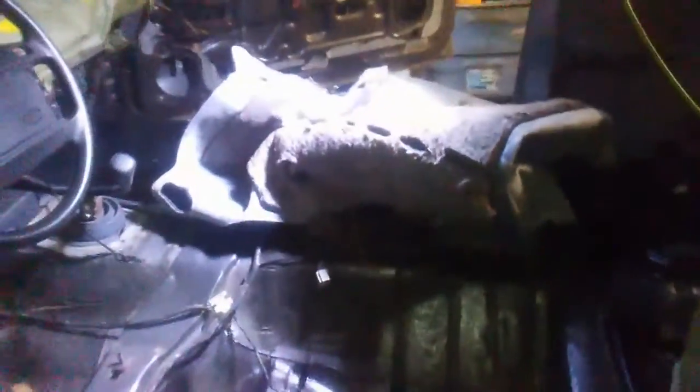I've got all the paint dried up on the floor here and I'm actually putting the carpet in. The primer's brushed on, the Lizard Skin's brushed on, the satin black paint is brushed on — all oil-based rust inhibitor stuff, the Van Sickle paint. And I'm working on getting the SN95 carpet in here, which will match the seats.